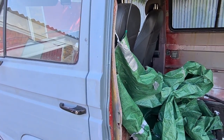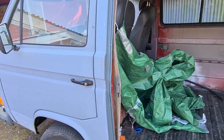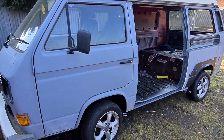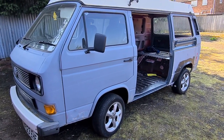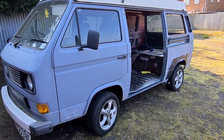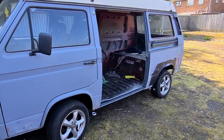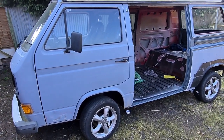I'll show you some tips and tricks on the outside. We're going to spray paint this, but don't forget with this Rust-Oleum combi colour, they suggest you can roll this on. So I'll show you, even if you get a pretty bad finish or it's very orange peely, how to flat it back and mop it up so it looks like glass. And we'll go through every stage, even if we get some runs in, I'll talk you through how to get rid of them.